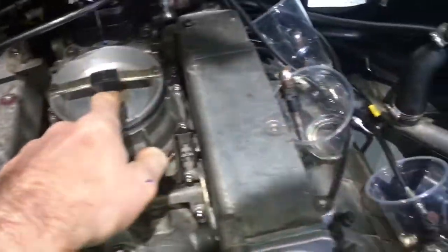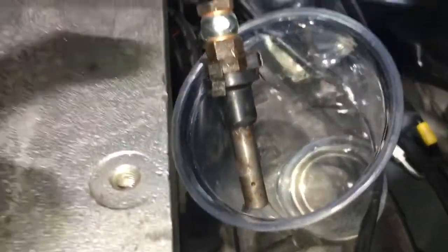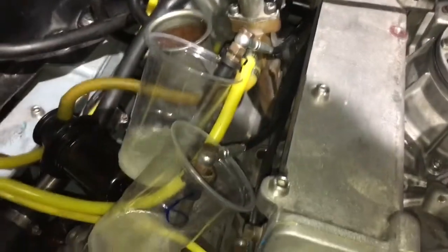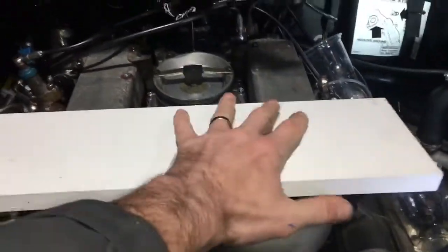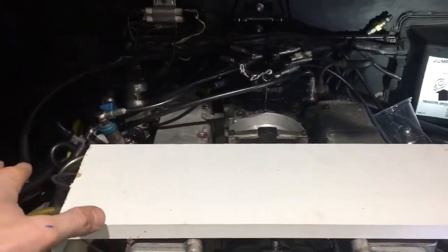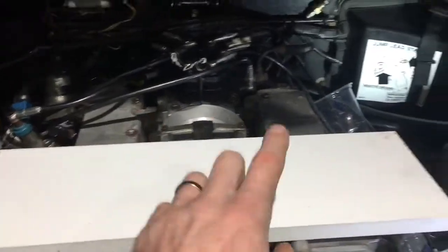It comes on at that, and all you do then is just give it a quick test. You can put the fuel pump on, and then with the other hand you can look at each injector, make sure it's spraying out. Right now it sprays out evenly. You can do this a number of times, and then when you've finished, you can put a piece of flat wood on here, turn off the pump, and then take each cup in a row.